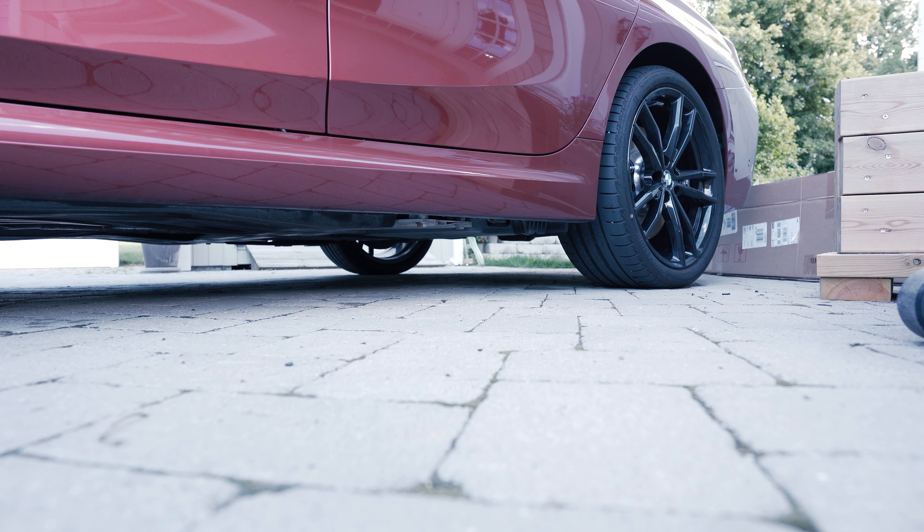The first thing we will do is lift the car up and put it on my home-built wheel cribs. This gives us more room while working on the rear end. I've already chocked the front wheels, and this is much safer working on this surface compared to jack stands because the wheel cribs cannot tilt, so that feels much safer.